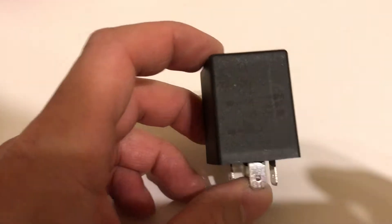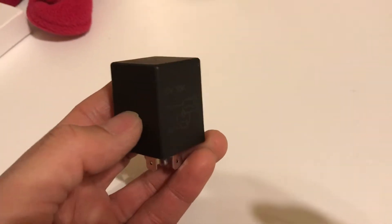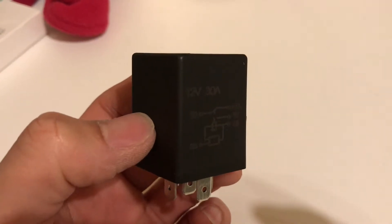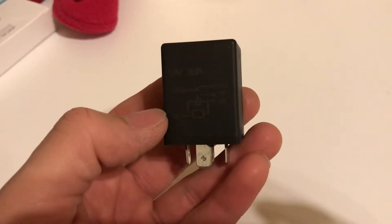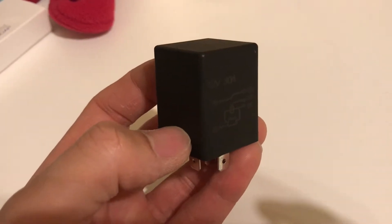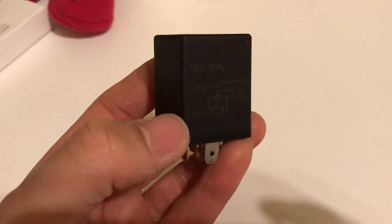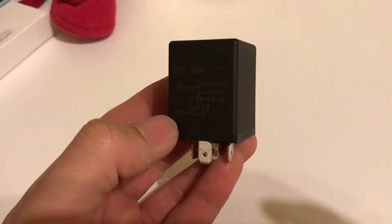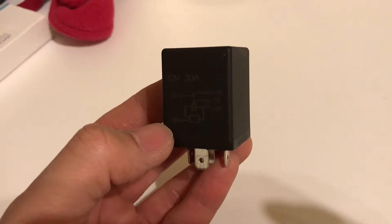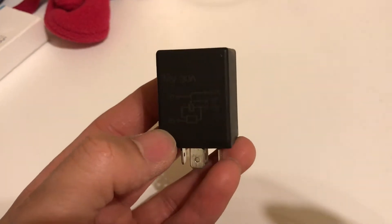Today I'm going to be wiring up this new time delay relay that I bought off eBay. It was sold by IJDM toy — it's a standard relay but it's got a 10-second delay on it. It's for people that have HIDs on their motorcycles or cars with auto-on function. You want to preserve your ballast and bulbs so that it doesn't fire on when you're in the garage, then you start the car and back up in bright daylight and your HIDs are on for 10 or 15 seconds and then shut off.